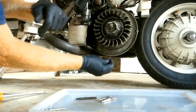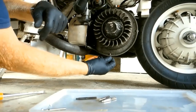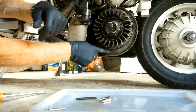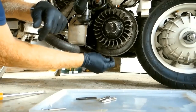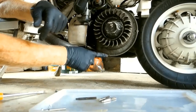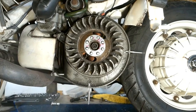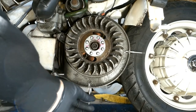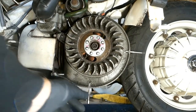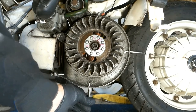You probably won't see it, but a little screw was put in this hole and it's threaded on the casing a bit, which is what was holding it in. So I'm going to tap that out to M6, and this one out to M6. I'm already editing this video so you might notice some joins. Tapped the holes out with a 6mm tap. The tapered tap bottomed out on the side of the casing here, so I finished it with a plug tap.